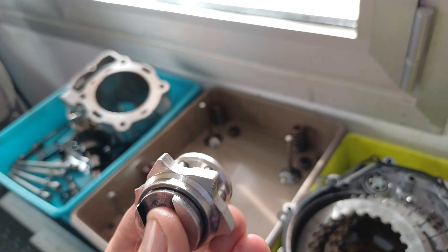Either side of the pin is where you can see the crank working hard — the webs are sort of distorting on the pin, so you get this kind of little effect here. Again, nothing too much to worry about, but it does show the stresses that these engines go under. Overall though, these are all good — nothing looking too worn or scoured.